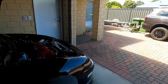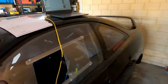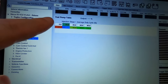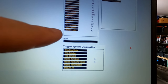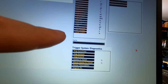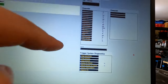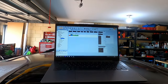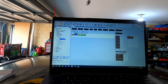That worked perfectly. As the fuel pump was priming I could hear it was barely running. And as soon as the car started up, as I was pointing out on the screen, it was in the first cell of the table — between 0 and 20%. While idling, the injector average duty cycle was 2%, so basically nothing. I'll be logging that duty cycle while out testing on the track so I can see where it sits throughout the rev range under full load and make any adjustments. I don't expect to be using more than 40% of these injectors, so I think I'll be pretty well set.